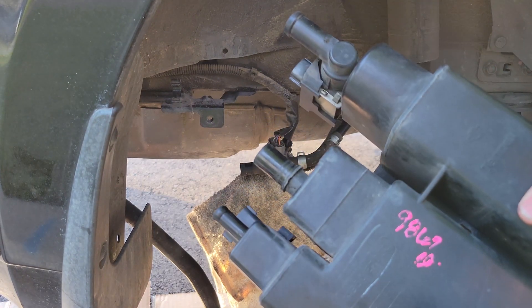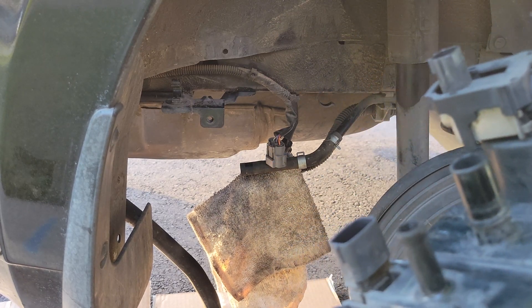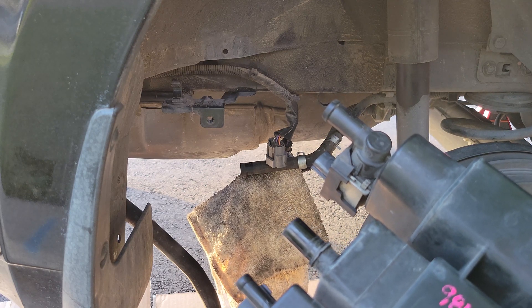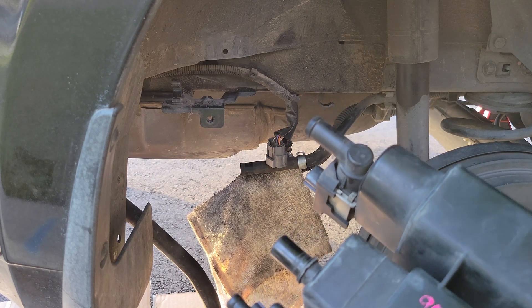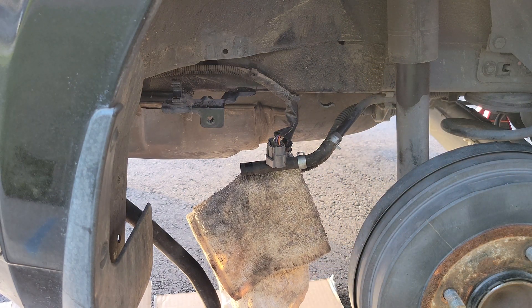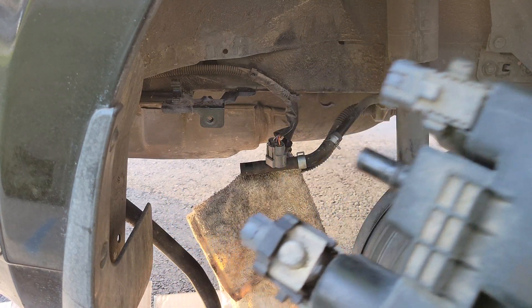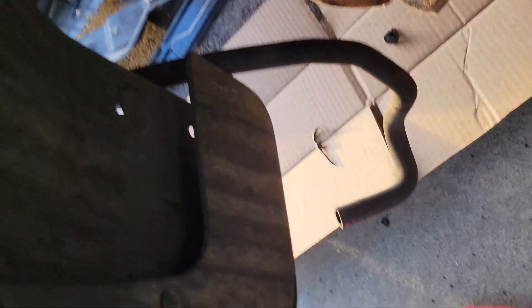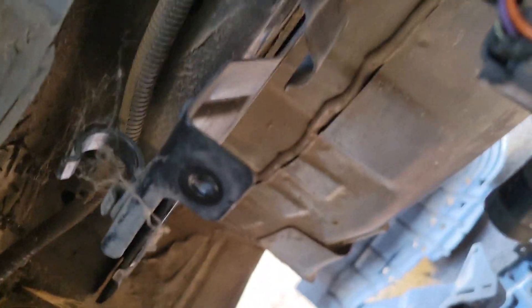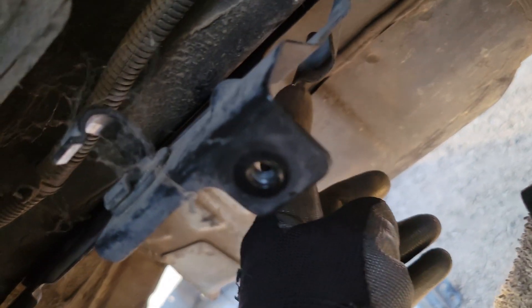I'm going to be installing the new canister, mounting it first before reconnecting the hoses or putting back the connectors, because reinstalling is not as difficult as taking them off. Like I said before, there's a notch here — you want that to line up with the hook that's on the mount. The hook goes right here and that's supposed to go inside the notch.